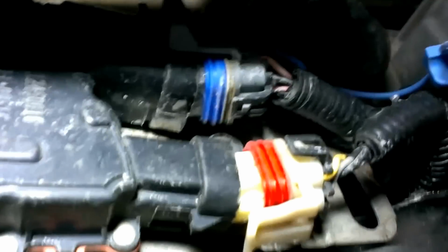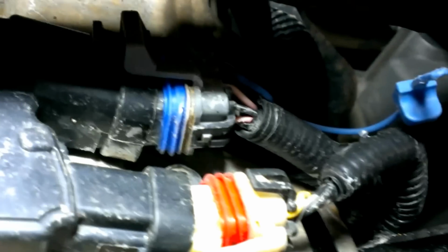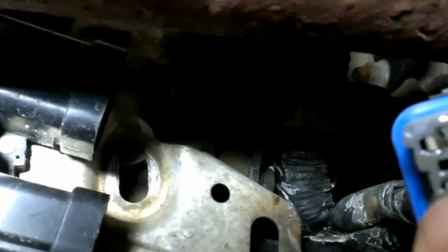And back here, you'll see a couple electrical connections. You'll want to heat those up with a hair dryer before you try to take those apart. There's some sort of adhesive sealant on there that makes it difficult to take out. There's one and two. I have an older one, that's why there's two. You perhaps saw a bolt fall out. It was back there. It's also 13 millimeter.